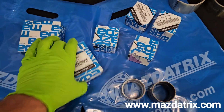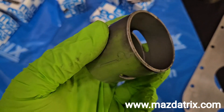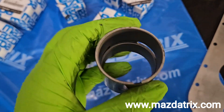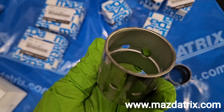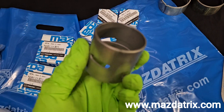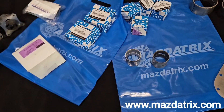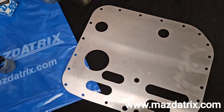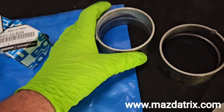Custom bearings made by Racing Beat, factory race bearings, or just OEM replacement bearings — your oil system is super important. Rotaries actually have really good oil systems from the factory, so make sure you're keeping that system operating at peak performance. If you're going racing or building a late model motor with multi-window bearings, make sure you're setting up the right pump configuration so you have enough volume for those big race bearings or enough pressure to sustain the RPM. That's why I like bumping up the pressure, making sure I have the highest volume pump, and running a baffle plate.